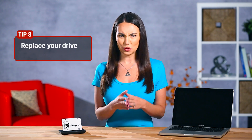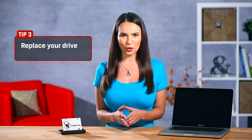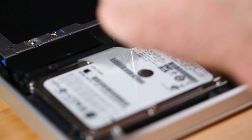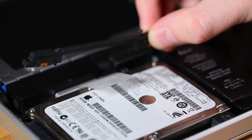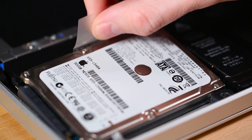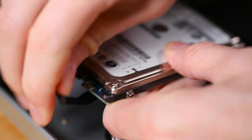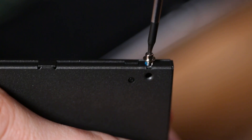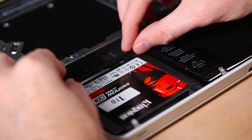After the cloning process has completed, it's time for a little light surgery as you shut down your Mac and replace the internal hard drive. For this early 2011 edition MacBook, you need to remove all the screws from the bottom. Next, disconnect the battery and remove a pair of screws holding the old SSD bracket. Now, just lift the old drive out. Remove the SATA cable and the hard drive retaining posts. Plug in the new drive, put everything back together, and you're good to go.